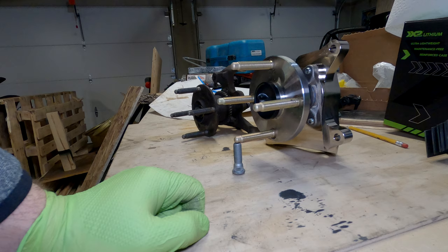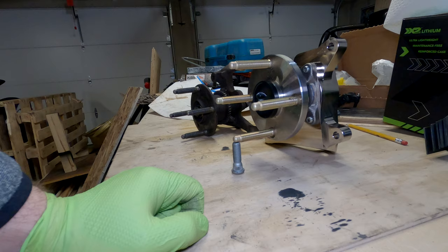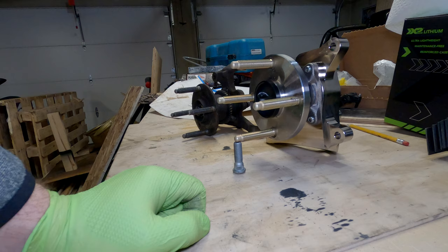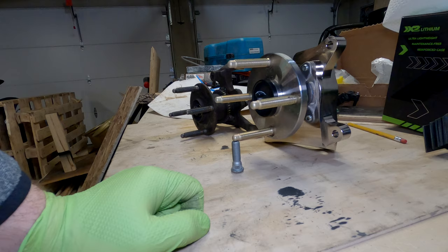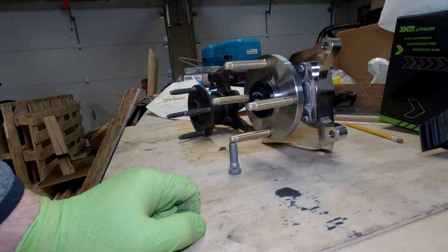Having that unfavorable roll center condition hinders your suspension's ability to work. The drop spindle adjusts for that, so you can have the roll centers closer to where they were designed to be from the factory while still having a lower ride height. It also adds some built-in negative camber, so it's made for track setups where you want to run a fair bit of negative camber.